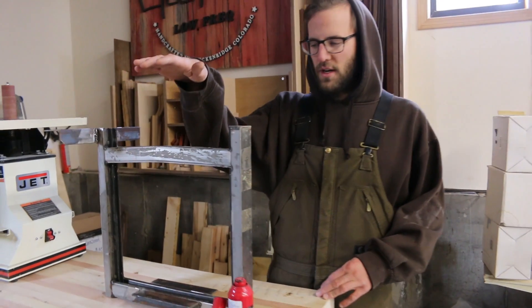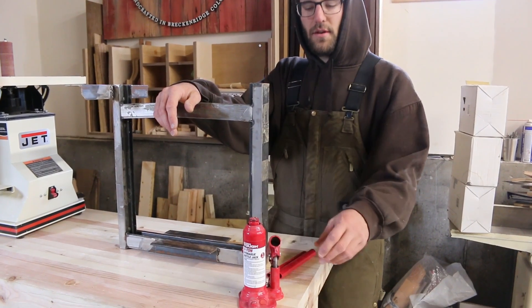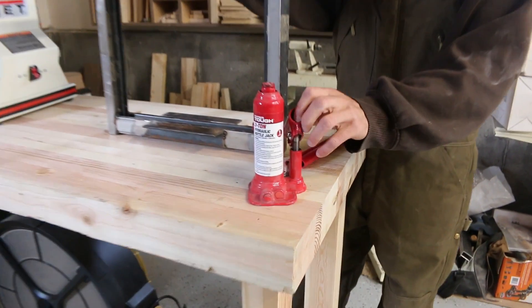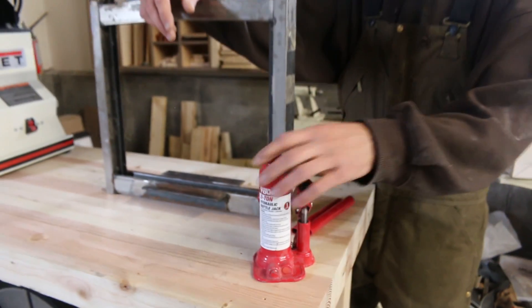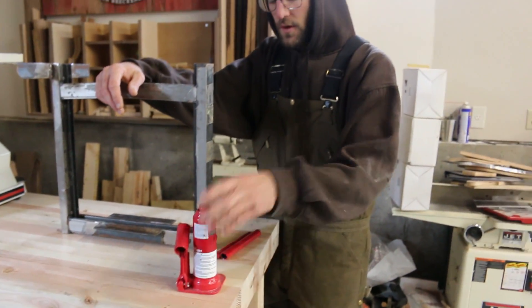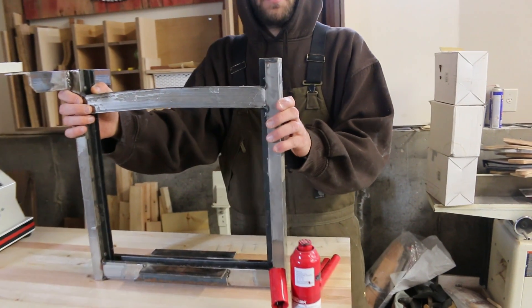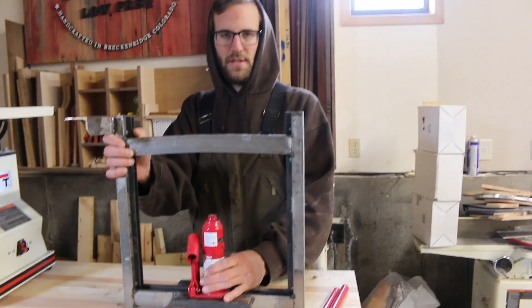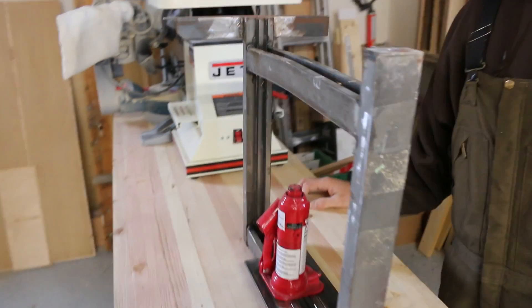Another tool you're going to need is a hydraulic press of some sort. This is a cheap little one from Walmart, it's like $12. So if you don't think you can do this yourself, you totally can — go to Walmart or Craigslist and find a cheap jack. Then you're going to need a welded frame of some sort where you can have the press and be able to press these joints in and out of the A-arms.